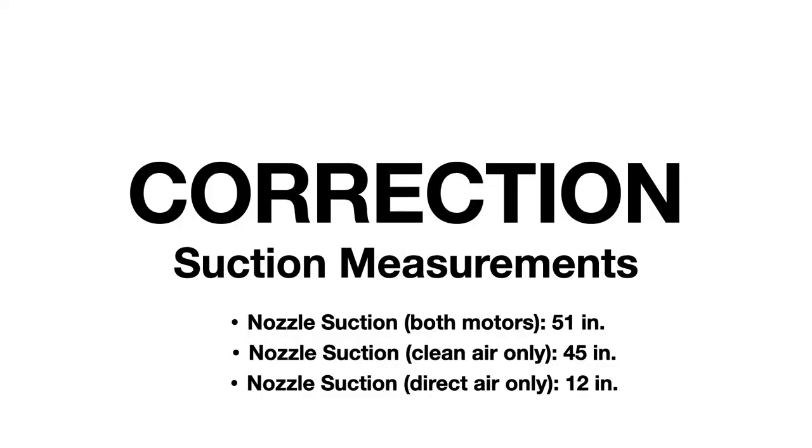So I'm just going to interrupt the video real quick, but I just have a correction to the suction measurements. It was pointed out to me, thank you, Bill from VacLab, that my suction gauge in this video was miscalibrated. It's about 8 inches of water lift too high. So all of the measurements that you see on screen, I've subtracted the 8 inches of water lift from. So the ones you saw on screen are correct. I put them on this slide so you can see them again. But hopefully by the next video, I'll be able to get the gauge calibrated. But just to clarify, these are the corrected measurements for suction. Now back to the video.